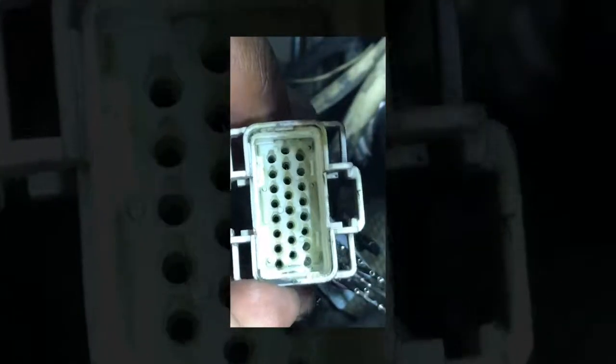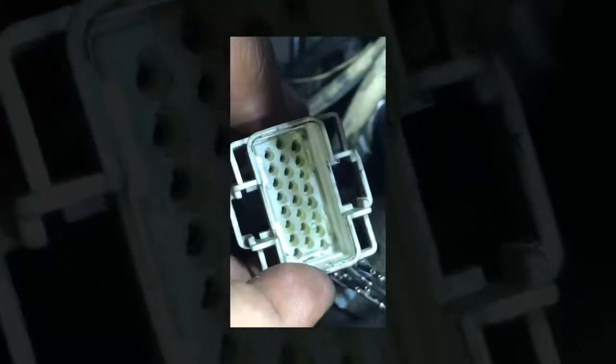That'll take care of this electrical connector. This is very tedious so I'm going to do this on a time-lapse. Basically all we have to do is get all these wires into their corresponding holes, index the connector, and lock them into place using that little white sliding plate in there. Once that's in place we should be all right.